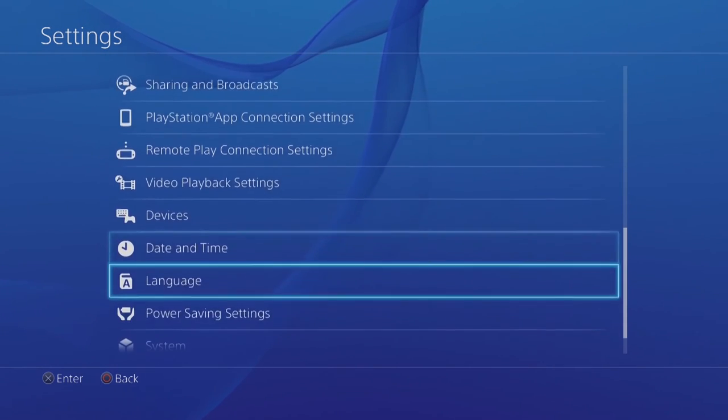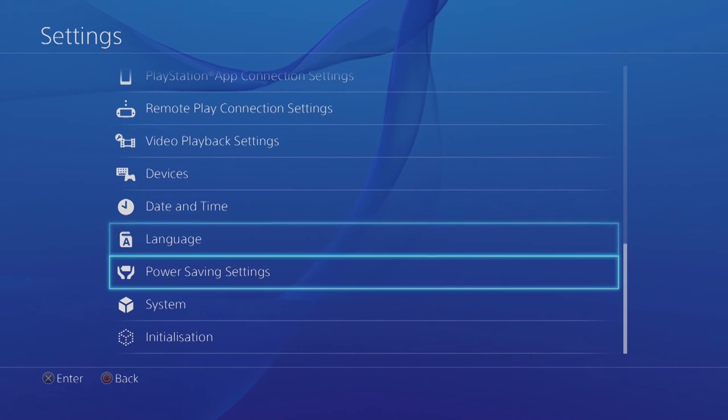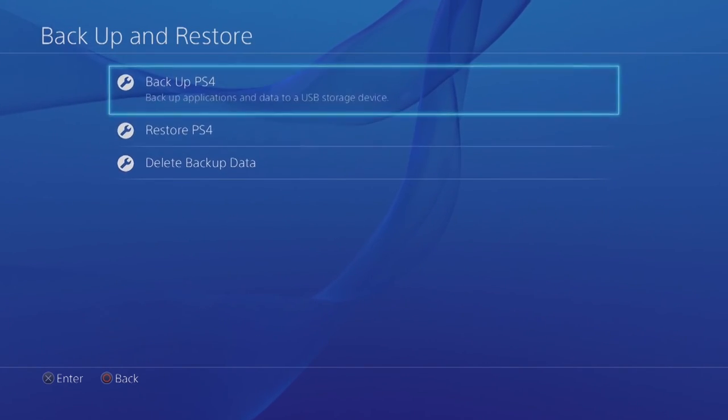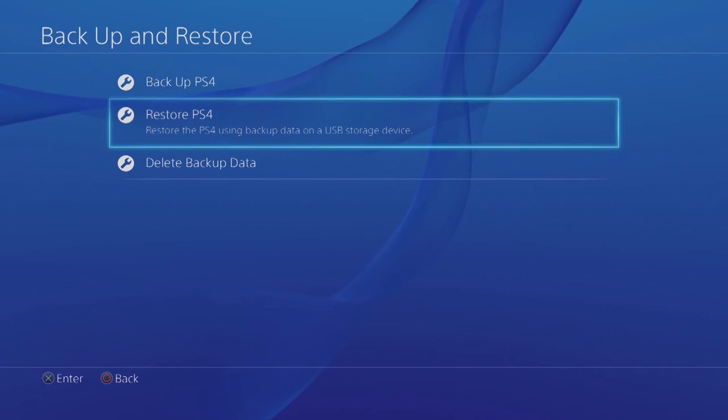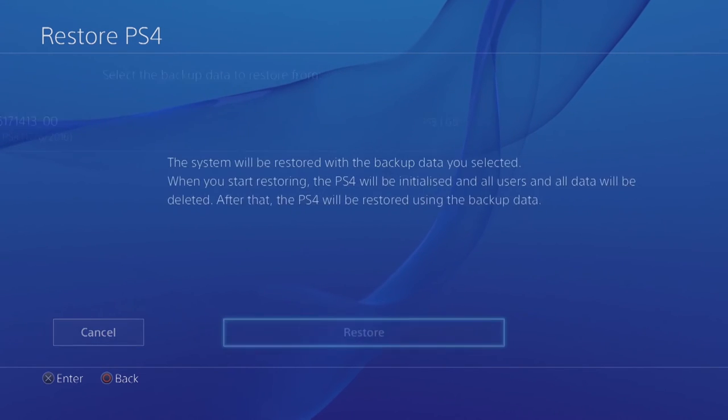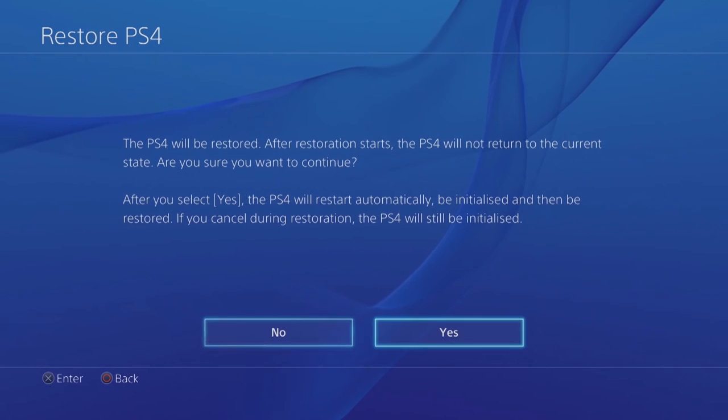And then you should be able to plug it in and go to system, backup and restore, like I said earlier, and then go restore PS4. Okay, and in here you will find your backup file. Just click on that. Now click on restore. The PlayStation is just going to tell you that it will restart after it's finished